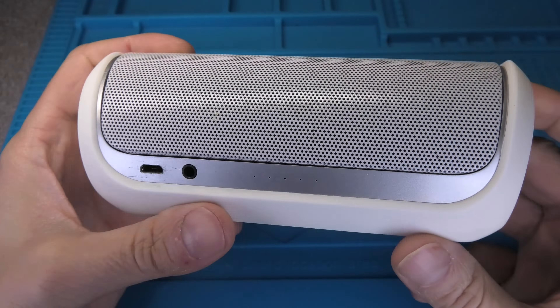Next I am going to look at the side with the buttons and we are going to remove this entire panel, but we want to do this really carefully. First we are prying loose this rubber piece that is behind the button panel, and then we see there is this black goop that is kind of sticky. Behind there is also a really fragile ribbon cable, so we don't want to accidentally rip that off — that would be really bad — so really be careful when you remove this.